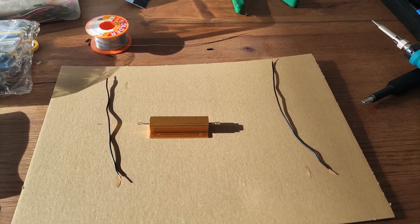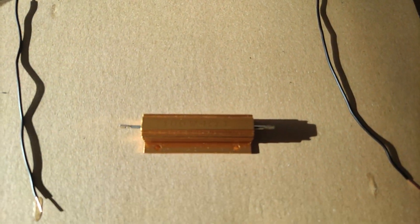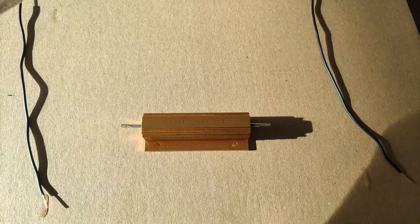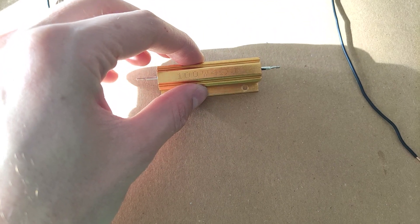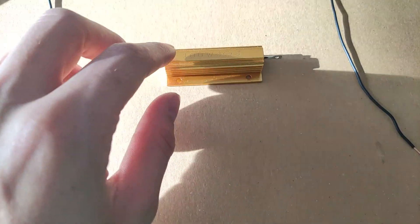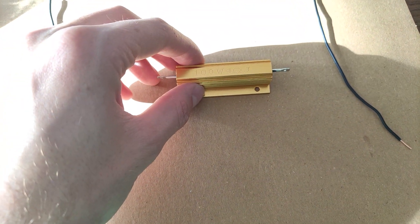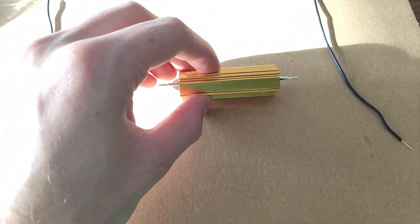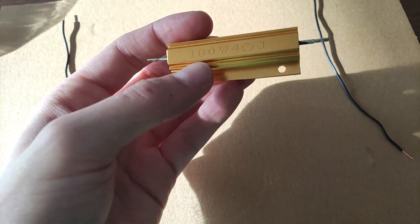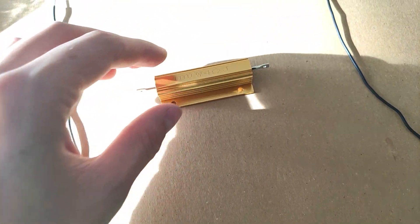So this is all you would need. You need a resistor that's 4 ohms and at least 25 watts. I've seen people use smaller ones such as 8-watt resistors, but the speaker is rated for 25 watts, so I don't want to risk it. I went with 100 watts since the price doesn't really change a lot — better be safe than sorry.